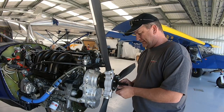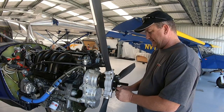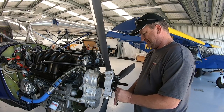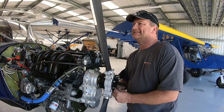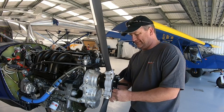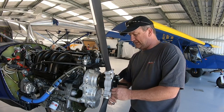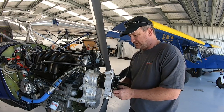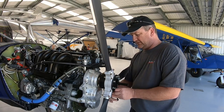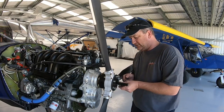And being 8mm, they are 13mm heads on our metric system. Now all I'm doing is taking this up so that it's snug. If you push down too tight on this, then it'll lock your blades all in place and you won't be able to do your final setting.